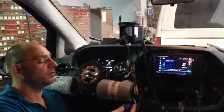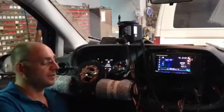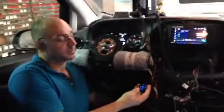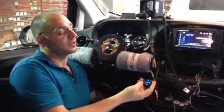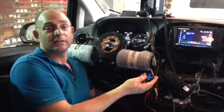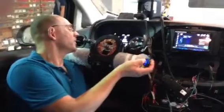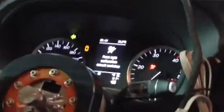At any time we can move to mode 2 — mode 2 is used for the tiptronic, so the gear should be in drive and the car should be driving. To move to mode 2 you have to press and hold — double beeps. Then when we briefly press, we can shift down; press and hold to return to normal or to drive.